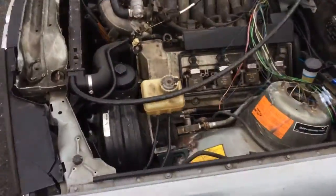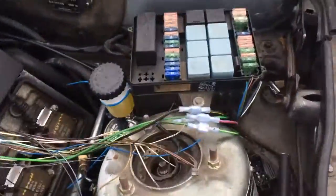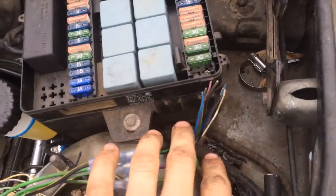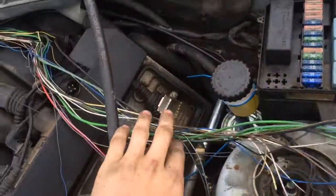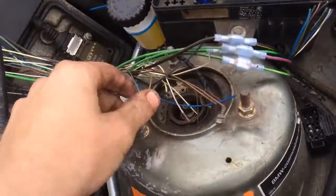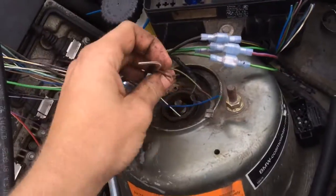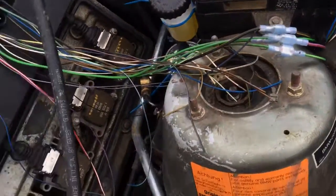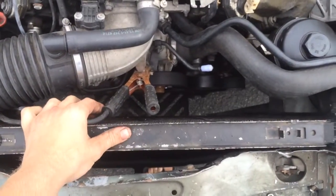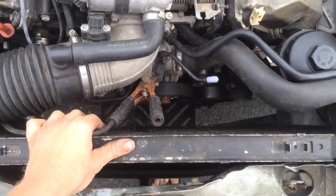There is the V8. This is just enough to get it running. This is the main wiring from the C101, which is a square style — that's the engine harness. A couple more connectors are for tach, oil pressure, fuel economy, vehicle speed signal, stuff like that. This was just enough for basically fuel pump, ignition, main power. It does have a E28 535 radiator. Let's see if it's wet in there — that's where it's leaking.